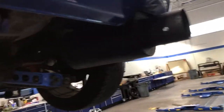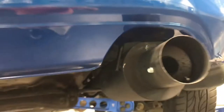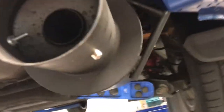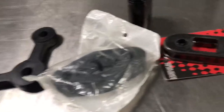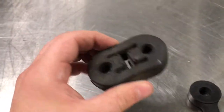Today I'm putting on some exhaust hangers on the rear part of the muffler — the axle back. The mid pipe came from another kit and the flange twisted a little bit, so it's rotated slightly to the right. I just bought some extended exhaust hangers — bought three to see which will work best, because these ones are just a little too short.